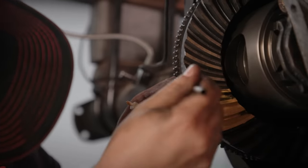The interior still needs work — we still have to do something about these seats. One of the things we're doing on this test drive is listening for squeaks and rattles, and I'm not hearing any. Also we're heating up the lube in the rear axle for the new ring and pinion to do a proper break-in. You want to get the rear up to operating temperature, park the vehicle, let it completely cool, and then maybe do that one or two more times before you do anything hard or abusive with it. It's just good practice.